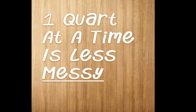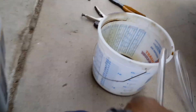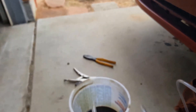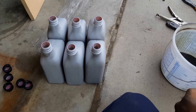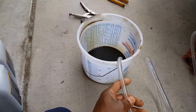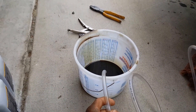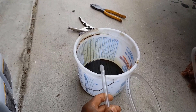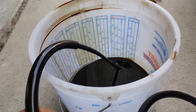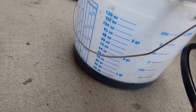It's easy if you have two people. The way you do it — let out three quarts at a time, that's what I'm gonna do. This bucket shows me three quarts; I'll say stop when it's getting close to three, let everything else come out, then drop three quarts back into the transmission and start it. This is the darkest transmission fluid I have ever seen, so at three quarts we'll stop.